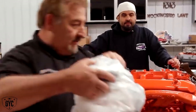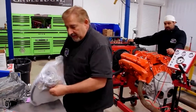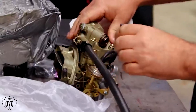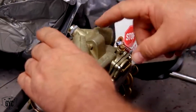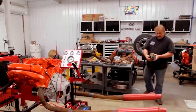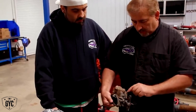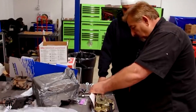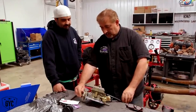These are brand new reproductions of the original Holley carburetors. I'll end up changing out a couple of bolts on them. The biggest thing you notice is this one has a hex head on it, whereas the original Holleys have a large flat screw. So you can take these out and put the original ones in. Here's an example of the original screw — that's the flat tip instead of the hex. Once we get this thing running and ready to go in the car we'll switch those out, but right now I don't want to mess with the carburetors. This is the center one — you can tell by the linkage. That linkage right there doesn't appear on the outboards.